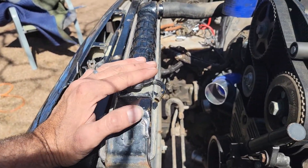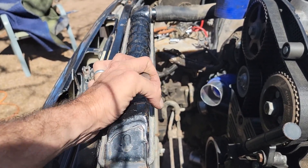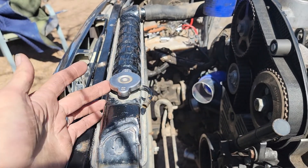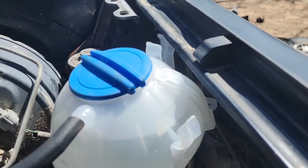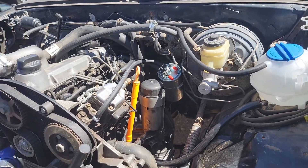The Toyota radiator works just fine as long as you just don't use the overflow bottle part of it. Cut this off and weld it shut, or block it off, or do whatever you want. All you've got to do is have this be a cap — this doesn't have to be anything anymore other than just a filling reservoir — and then make sure it seals there good, because you're going to have the VW bulb instead.